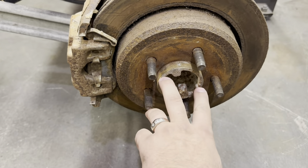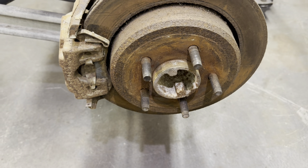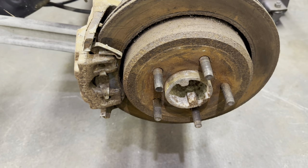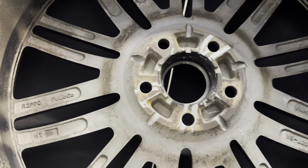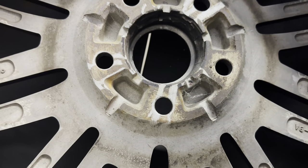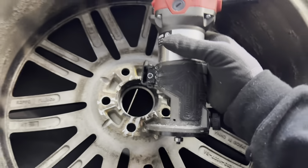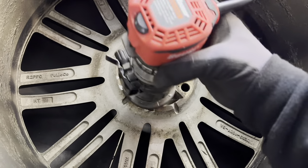Looking at the hub, we got two and three quarters — that's what we need to hog the center of the wheel out to so it'll fit over it. It looks like it's about five-eighths in. I'm not going that deep; I do have a small wheel spacer I'm gonna put in there. The previous owner has already attempted to clean some of that out. These are hub centric, so you're supposed to be up against the hub tight so nothing moves around. I got this router and I'm gonna put the right bit in there and buzz around this edge.